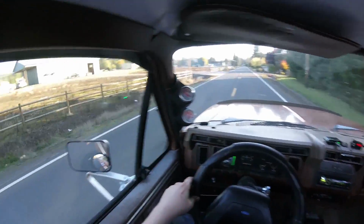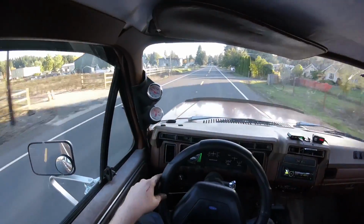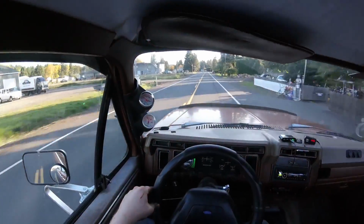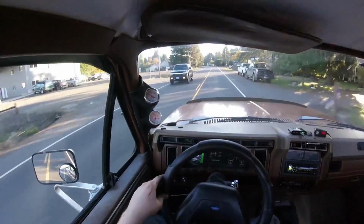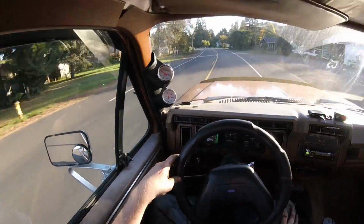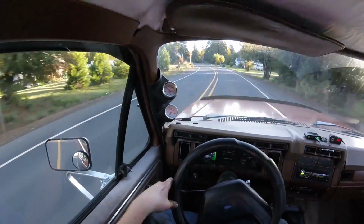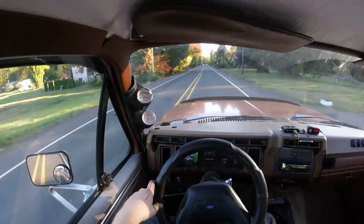Much happier. So the next thing we're gonna do, the steering links on it are completely blown out, so that'll be the next priority on that. And also the brake caliper slider bolt, it was snapped off from a previous job, so we're gonna have to drill that out and re-tap it, probably for a larger bolt, unfortunately.